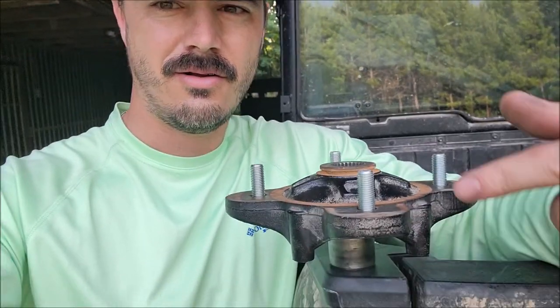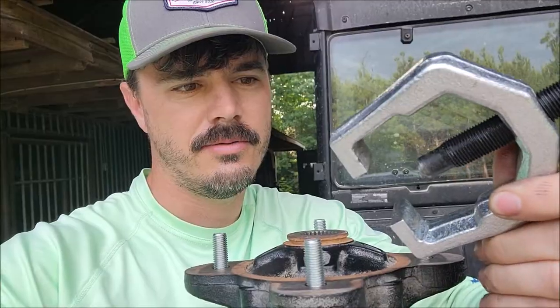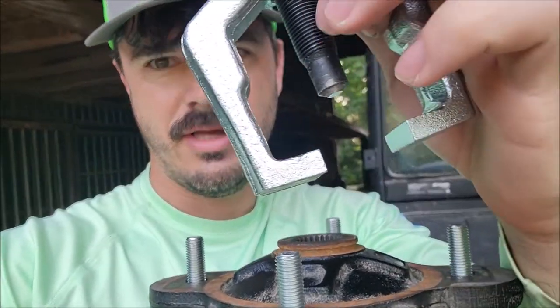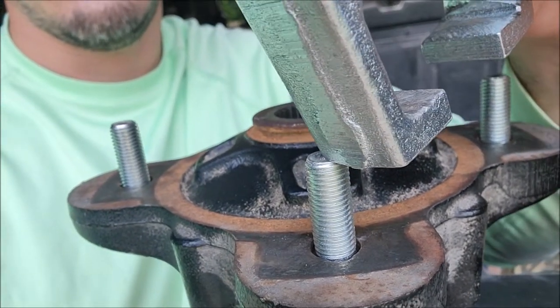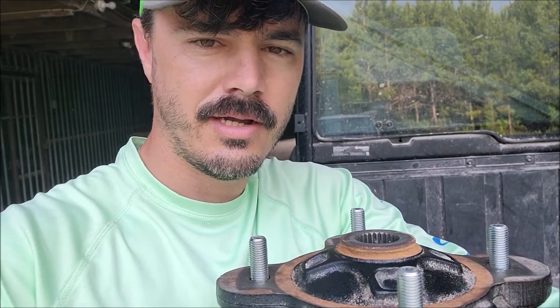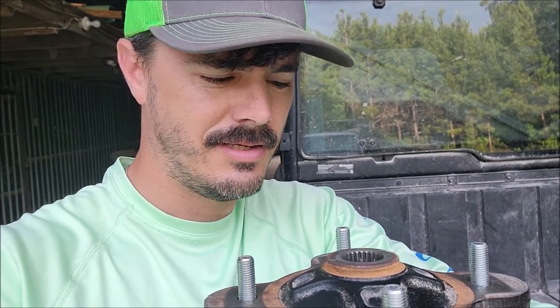It's the next day and we've got all the wheel studs replaced in the hub. It just took the use of a pitman arm puller to press them out. One of the two had sheared at an angle, so I had to get a drill bit and grind it down so that the post of the pitman puller would settle down into it and we could press them out. The originals had a kind of indentation, so the post set down on them really nicely and we got all of them out. We went ahead and replaced all four as you can see here. Hope this video helps you in case you have any sheared, bent, or stripped wheel studs. Thanks for watching — we'll see you next time.